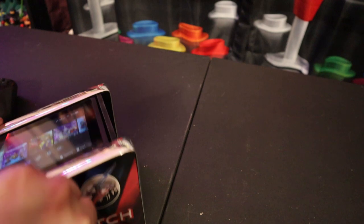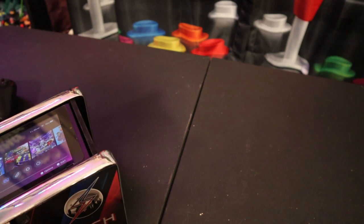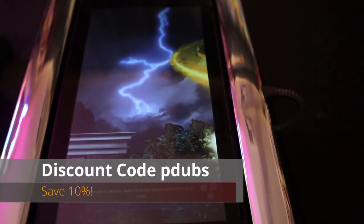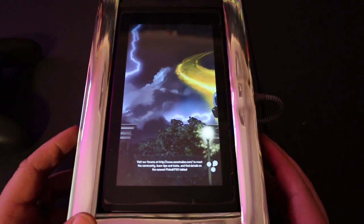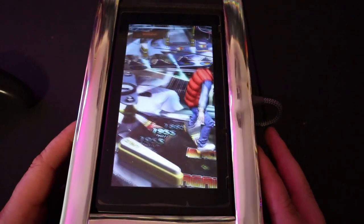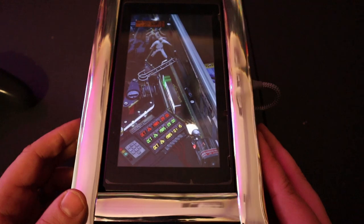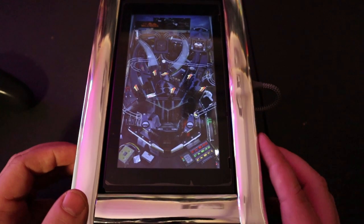Get that cable connected. Make sure your Nintendo Switch is turned on before you put it inside the cabinet — hit the power button and go to the main menu, because if you don't press A to continue right away, it automatically goes into sleep mode and you'll have to pull it out of the cabinet again. A very important step: once everything is hooked up, use your Pro Controller and head to settings. Go down to controller settings and make sure the Pro Wired controller setting is turned on. If that's off, your Nintendo Switch won't read the USB encoder board. After you turn it on, your controls will work, and it's time to play some pinball.